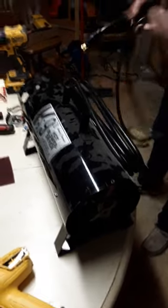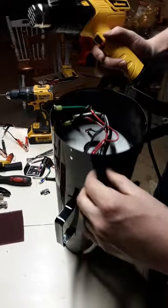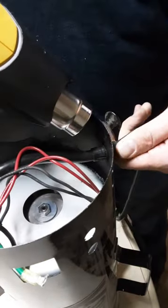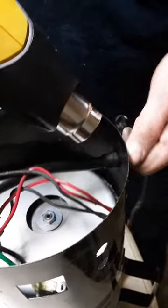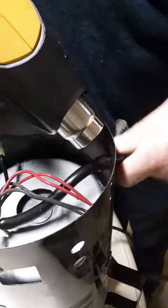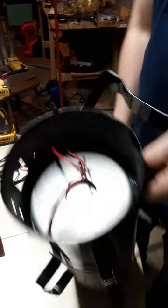The last thing will be the cord — this is where the heat gun will come into play. There's a rubber grommet that pokes through the cord hole. You want to heat that grommet up and then it will pull right out. Just twist the cord back and forth so it heats the little grommet up without melting it — it doesn't take a whole lot. The cord should just pull right out. That's the grommet right there — that's pretty much everything on that side.